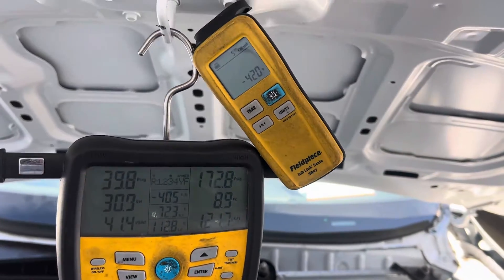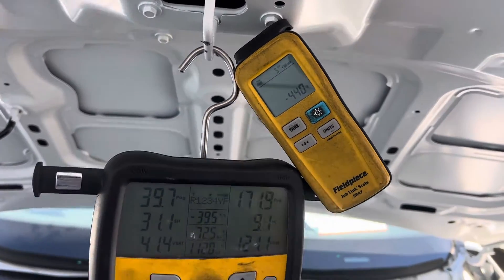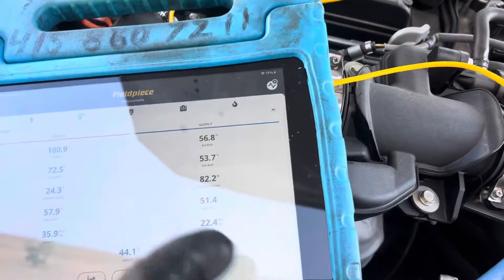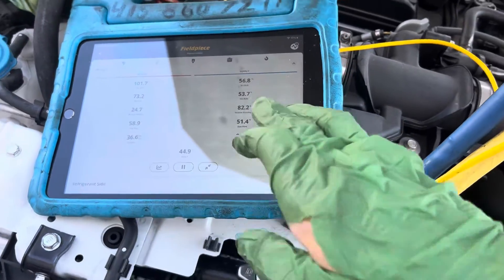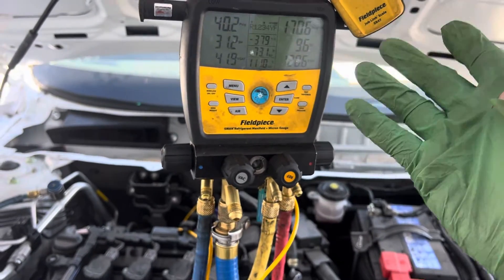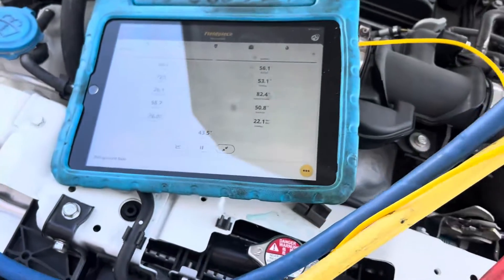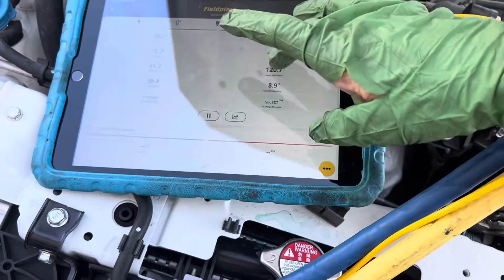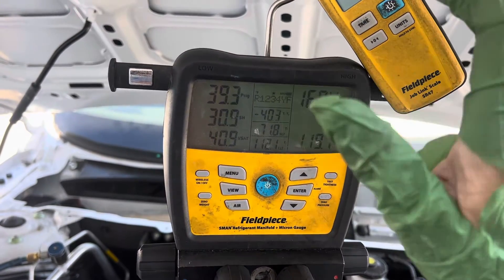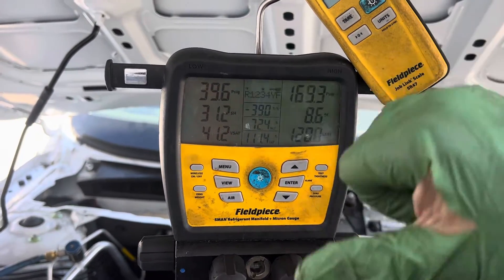A little more flick — boom, right there. That's it. Done deal. We have 102 degrees, 101 degrees going over the evaporator, still 56 degrees coming out of the dash. We haven't seen much change out of the dash even though we've gone from around 240 grams to 445 grams. Our out-of-dash temperature has almost not changed. Superheat is at 30-31. We are 100% factory filled. Our subcooling is going back and forth around 8, up and down within a point.